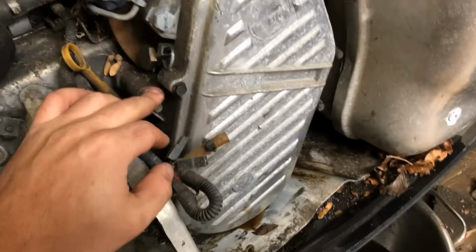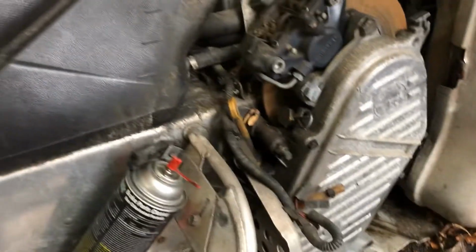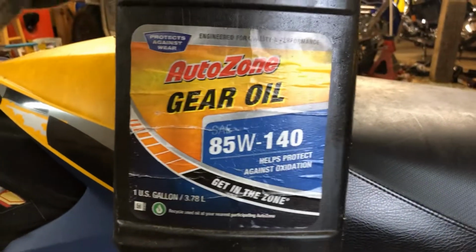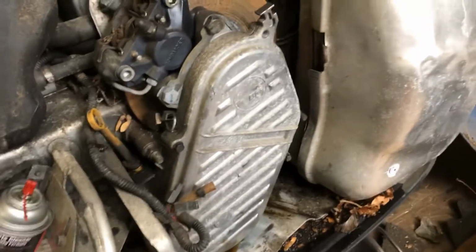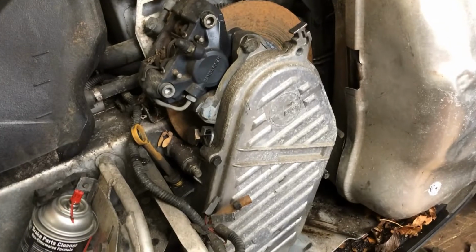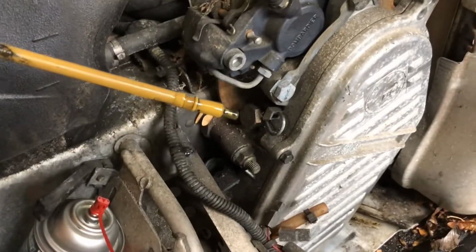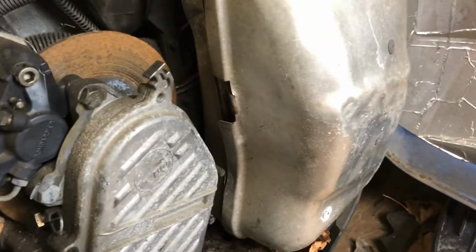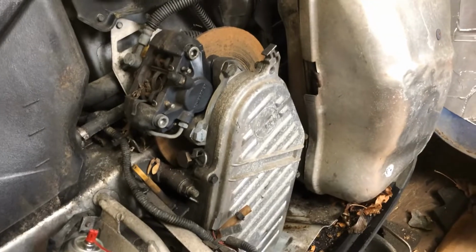After a few gas flushes, I get the inside of the case pretty clean, and then I just threw some gear oil in it. This is not Skidoo recommended, but I did 85-140. I really don't imagine it to be that critical. And honestly, I winged it as far as how much I put in there. I have no idea how much I put in there, but it is within spec. It's supposed to be right on that line. So I'll post the fluid capacity in the description.